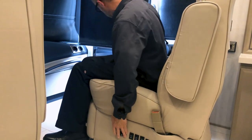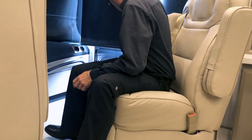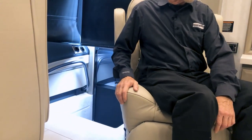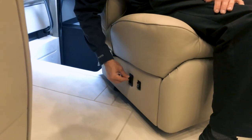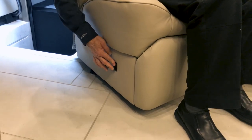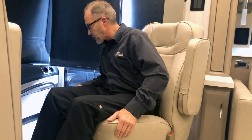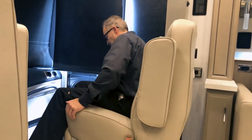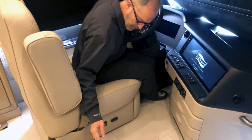For the driver and passenger seat, the electric motor adjustments are: seat heat (heats seat and back), seat back forward and back, lumbar support, footrest in and out, and the entire seat moving forward and back or tilting. To rotate the seat toward the living room, there's a lever on the right-hand side as you sit — pull it up to unlock and rotate the seat. The headrest moves up and down with a switch on the right side. When rotating back to the front, the seat clicks and locks back into position. The driver's seat has the same controls, except the footrest will not extend when the ignition is on — a safety feature to prevent it from interfering with driving.